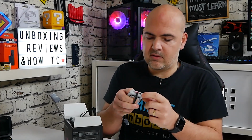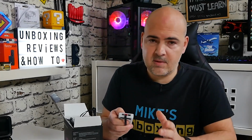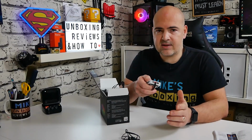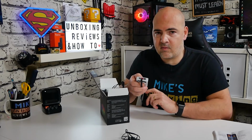And also there's an option on the side there for the auxiliary input for RGB from your motherboard. So if you've got an RGB motherboard which has the 5-volt 3-pin section, you can plug that in nice and easily. And also there's an option on the side there so you can actually repurpose your reset switch from your case and plug it into here to take control of your RGBs. That is if you don't want to use the motherboard or the included remote control.